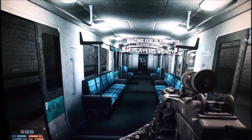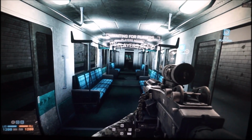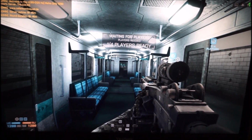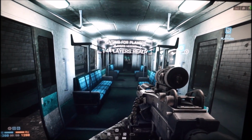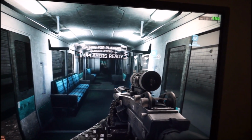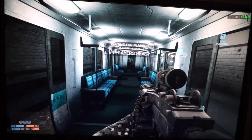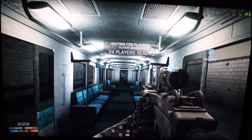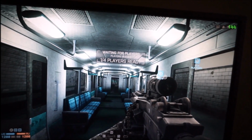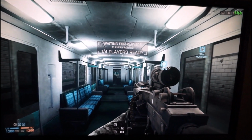It's something that we discuss in the written review, but also in our matte versus glossy monitors article. The point in this surface is to cut down glare. No one wants to game and see their face whilst they game. They want to be focusing on the content on the monitor instead. So it handles glare very effectively. So that's light striking the screen surface from your room. You don't get nasty reflections or troubles like that. But the light emitted from the monitor itself undergoes exactly the same diffusion process as the light that strikes the screen, so you do get a decrease in clarity as a result of this. But as I've said, it's not really too bad. It's a sort of middle ground.